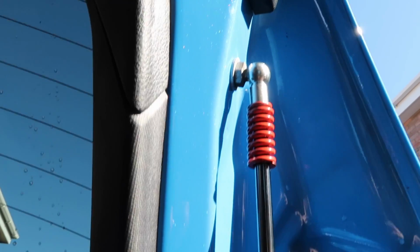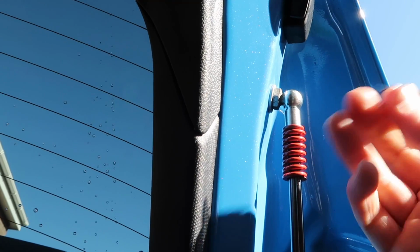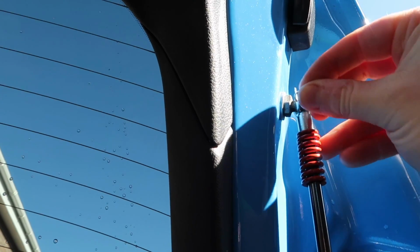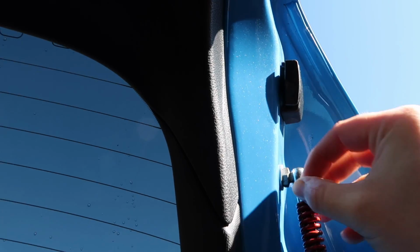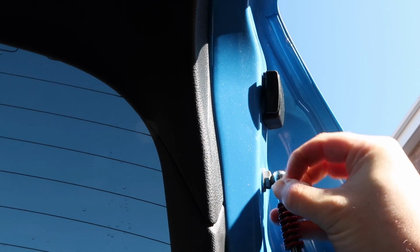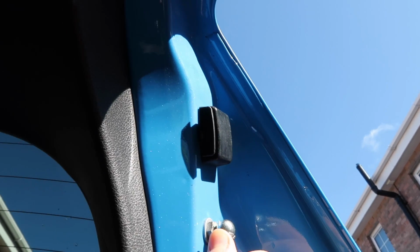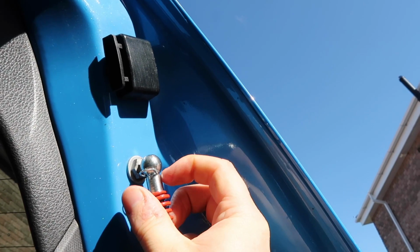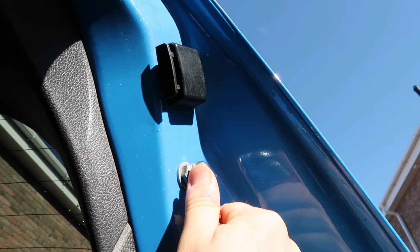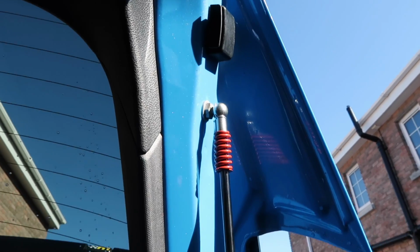Okay, the locking pins then, literally as you would expect, they just go in as we took them out. So there's the two holes that you will be able to find on one side of the little metal bit. So with the pin sort of outward, we just slot that up through. Yep, there it goes. So whenever it's up through, then we just line the hook end up with this ridge right here in the middle, and then give it a wee push, clicks into place, and that's it, locked.